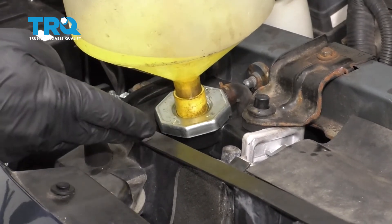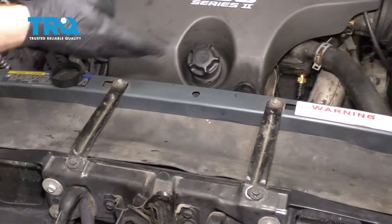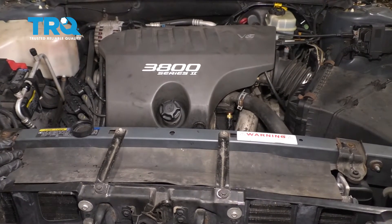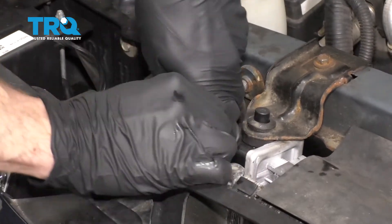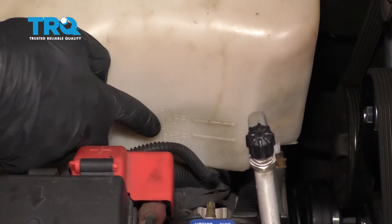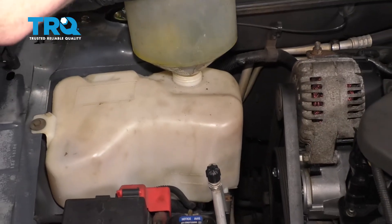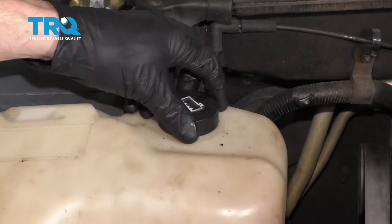Start up the vehicle and let it run for a while. What we need is for the cooling fans to turn on — once those turn on, that tells us the thermostat is open and we should have hot heat blowing out the vents. At that point, there shouldn't be any more air inside the system and we can turn off the car and remove the coolant funnel. Once you're sure it's full and there's no air in the system, reinstall the radiator cap and make sure it's nice and tight. Then make your way over to the coolant overflow and pay attention to the side — make sure it's up to the full cold line at minimum, and not too much higher than the full hot line. Just get it anywhere in between, then cap it off when you're done.